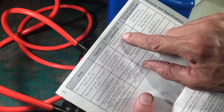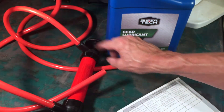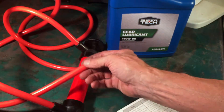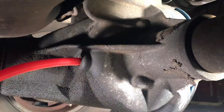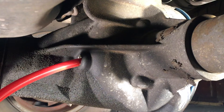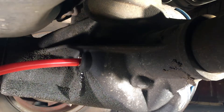The owner's manual calls for SAE 80W90 rear differential fluid, and that is what I have. Having a gallon jug, that's too big to get up there to pour, so I'm going to use a little suction pump. The top part is suction — this hose goes down into the gallon jug, and the discharge hose goes into the differential. There are some metal shavings on the back side, but I don't think that's enough to be worried about. I put the discharge tube into the differential and start pumping until fluid flows out. It's coming out. This is going to take a while — I'm at the five-minute mark already, so I'm going to stop filming and come back when it's full.